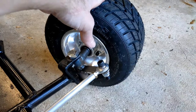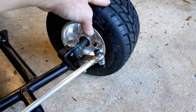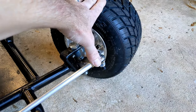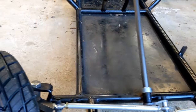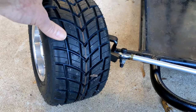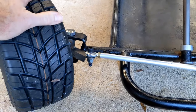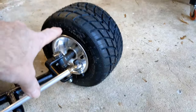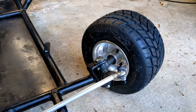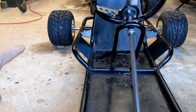When that wheel drops — the inside wheel — it's going to force it into the ground more, put more load on it, which will help reduce the effects of the turn and the centrifugal force trying to push the cart to the outside. This wheel with no weight on it is not even touching the ground right now. So when you're turning hard, it's going to transfer load to the outside and plant that wheel, but your caster is going to help the inside wheel stay planted by effectively putting more weight on it. Additionally, because of the diagonal angle, it puts more weight on the outside wheel in the turn.